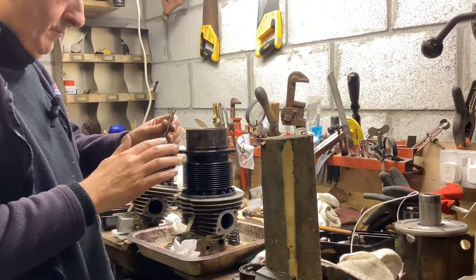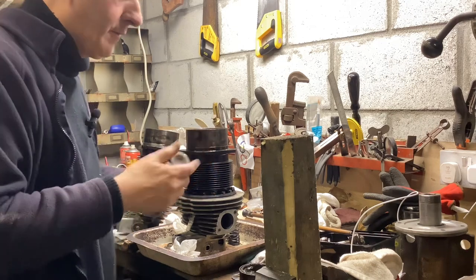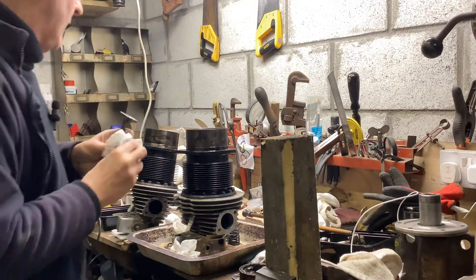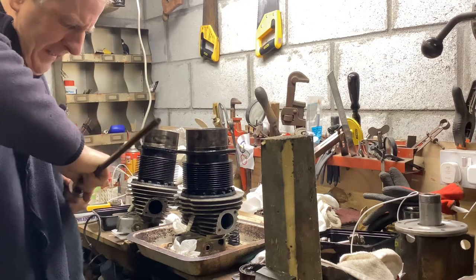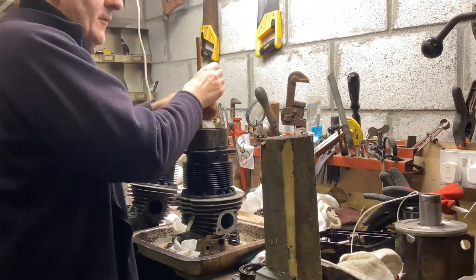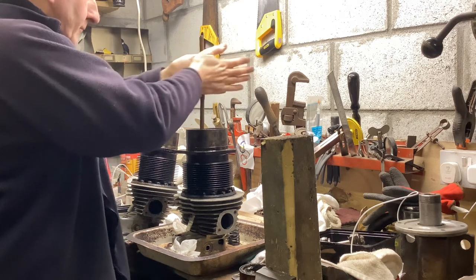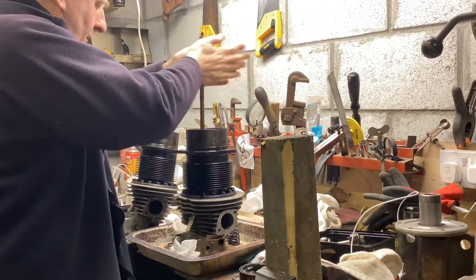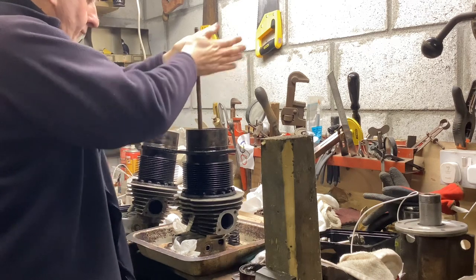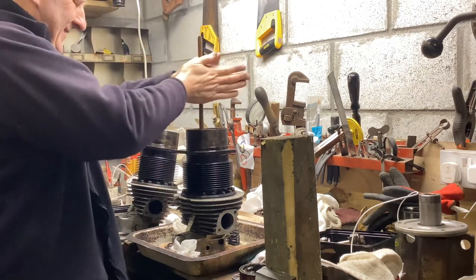And I think given that one valve stuck through carbon, and I think the inlet valve needs to come out, but I think I should do the exhaust valve on the other cylinder, because it'd be a bit bloody silly to only do this one and then find that flying it back from Bodmin to Roach tomorrow, it does exactly the same thing when I get to Roach. I wonder if it only stuck at low RPM when it was throttled back. I wonder if the lesser RPM was part of the devil, and actually with full throttle on, or not far off full throttle, because I was heading over for a bacon sandwich and Dotty was going to go home fairly soon afterwards. So we'll never know, I suppose. No, it's very pleasing that it's not an expensive job.